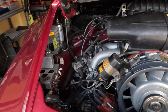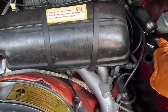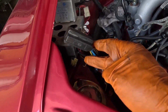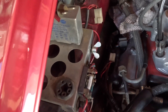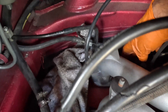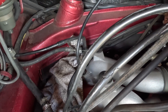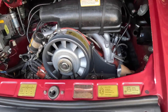Quick update: I've disconnected all the oil lines underneath the car, I've drained all the oil, and disconnected the two breathers on this side as you can see - they've been removed. Going to this side, I've unplugged the 14-pin connector, unplugged the power for the CDI, the external voltage regulator, and I've also undone my fuel line. There's the drain-back line from the accumulator, the supply line, and the return line - all undone. I've also disconnected the throttle rod off the top of the bell crank at the top here, which is a nice little trap you sometimes forget.